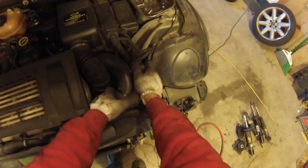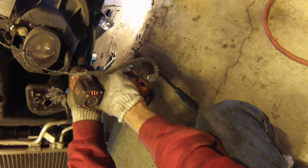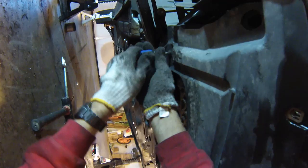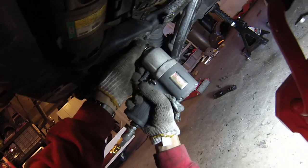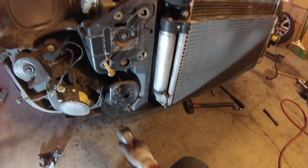Disconnect this air intake — this one, the clamp is missing. Remove the crash tube with 10mm bolts underneath here, one on each side. Next we'll remove the skid plate. After you've taken the 10mm bolts out, there's just two 90-degree screws on each side and that slides right out. Then use a 16mm socket to remove the crash tubes and tap them out with a dead blow hammer.